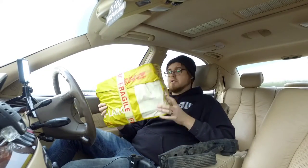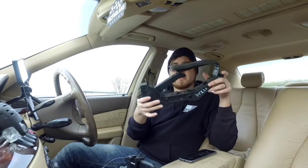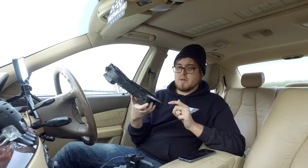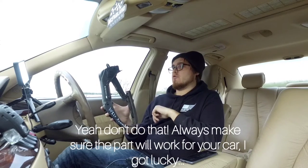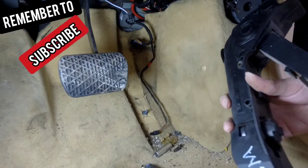Just like that, it's here. So we'll get this unwrapped and get started on actually fitting this pedal - touch wood this will cure my problem. So this is the new pedal, slightly different in very minor ways. I think the kickdown switch is slightly different but it should still work - it'll be the same pin out and should be a plug and play thing. I didn't actually look what W220 it was from, I just grabbed one in a rush, so hopefully this will work.